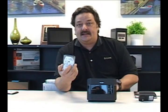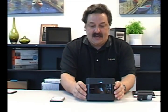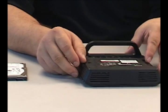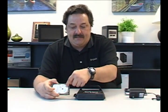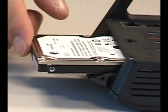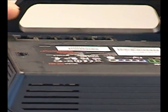The second thing we're going to want to do is install our two and a half inch serial ATA drive. It doesn't matter what size you get — the most important thing is that you get a serial ATA drive that's two and a half inches, like what you would install into a laptop. So all you have to do is take the router, put it face down with the stand facing towards you, and then flip down this little door. Take the hard drive so that the label is facing upward, slide the hard drive in until it's firmly seated, then close the door and that's all there is to it.